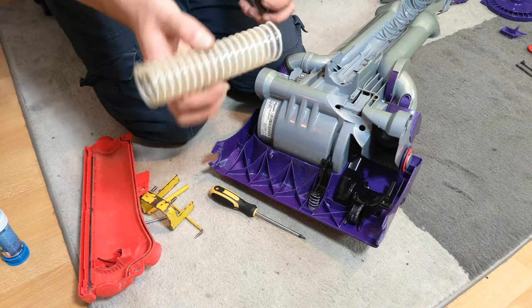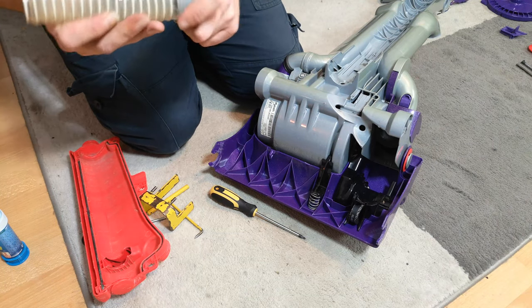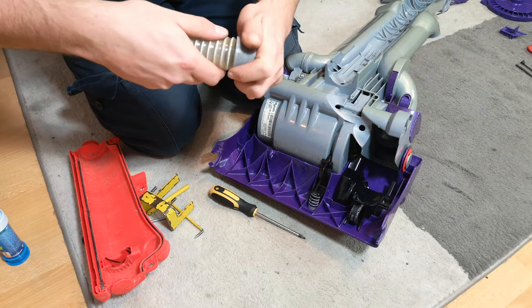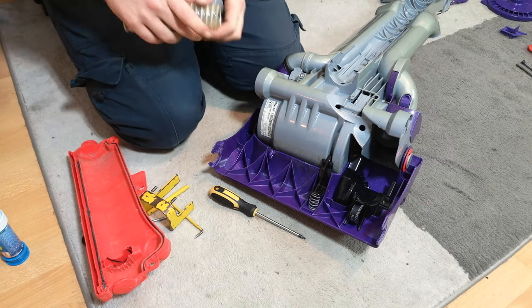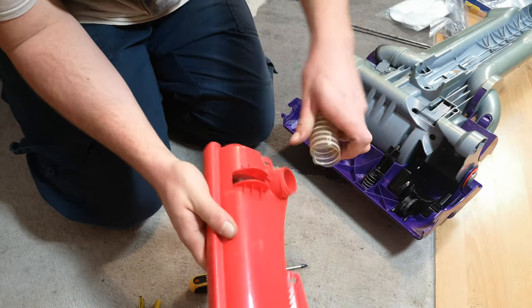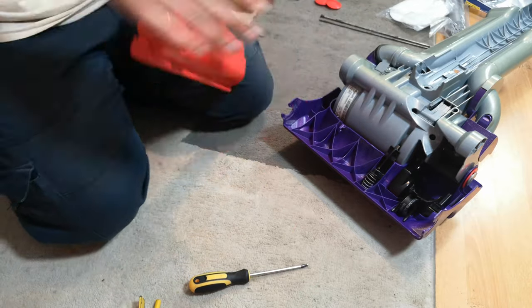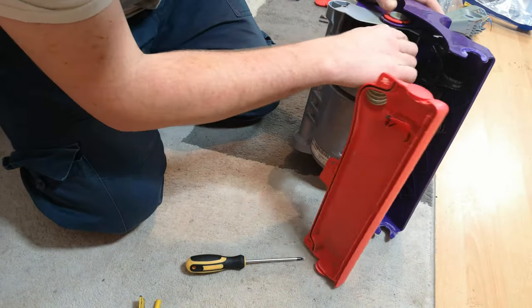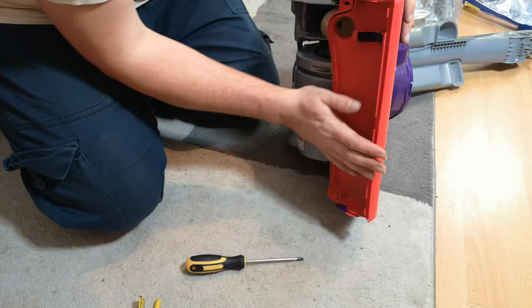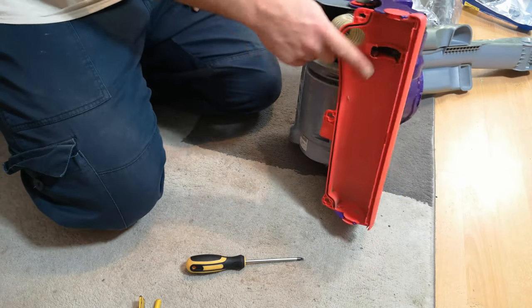Take all of the housing and the washed internal hose that has its spring back. These hoses do split — if yours is split, buy a new one, as taping it doesn't work. Push the internal hose on first, then the side pieces just slot into place. Check that you have a good bounce; if you don't, gently twist the hose until you do.